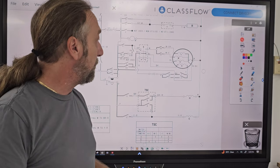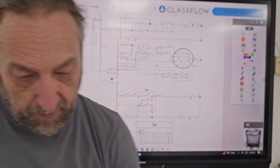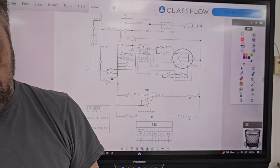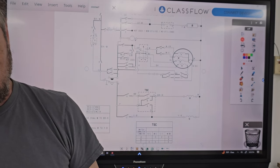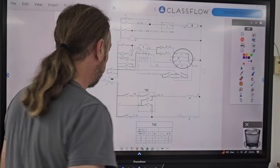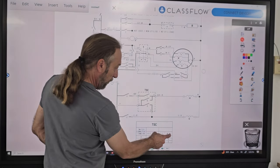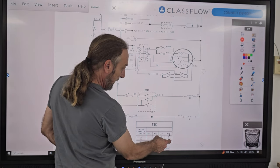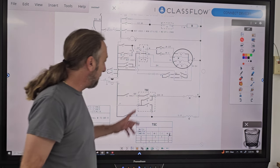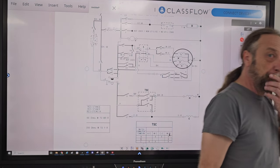And so the other part of the question was what? Which switches will be closed when the customer selects warm, warm? And that's 2B. No, that's A, B, and C. Okay, warm, warm. That's A, B, and C in this switch. So warm, warm. Actually, A, B, and C would be closed in warm. Yeah, A, B, and C. All three of them would be closed.